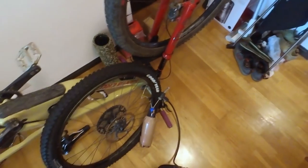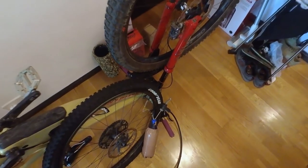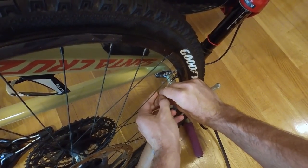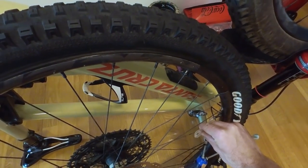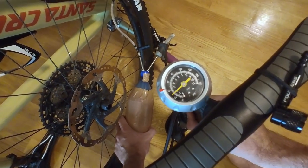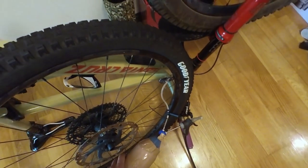I'm going to go for 140 PSI — 10 bar, 10 atmospheres. 140 odd. We're going to take off the safety release mechanism. Three, two, one. That went up pretty damn hard. I would say that's success — and it's holding 30 PSI. Bang on. So that sealant did the trick.